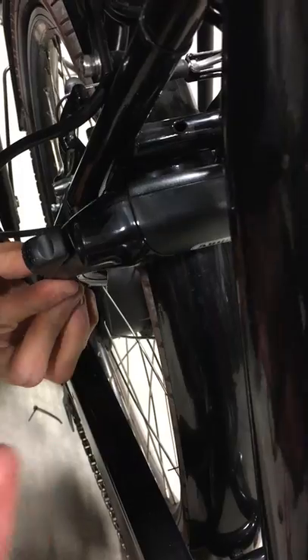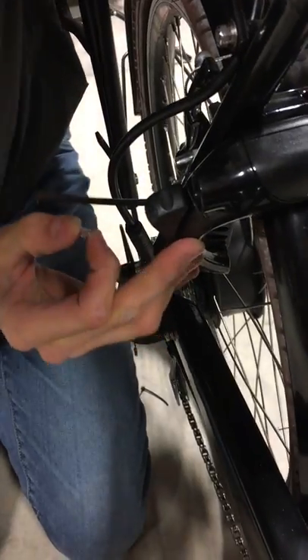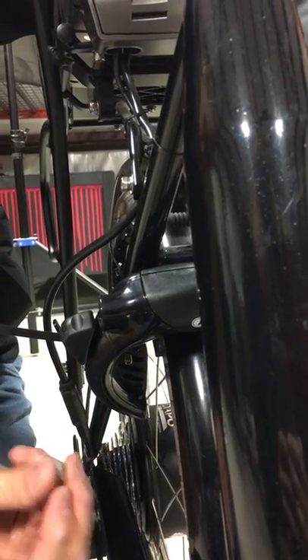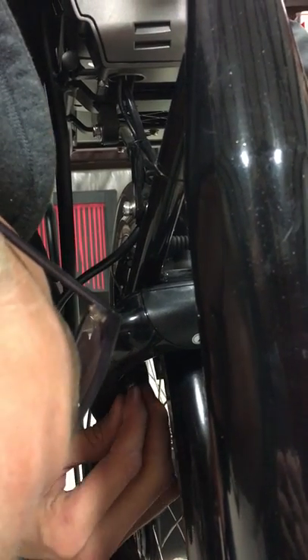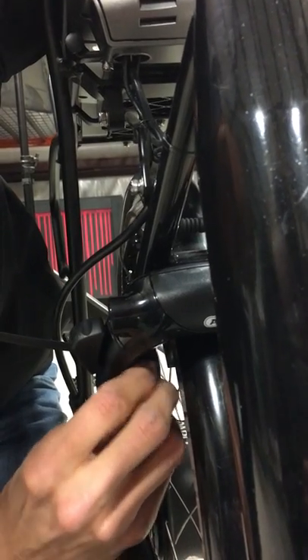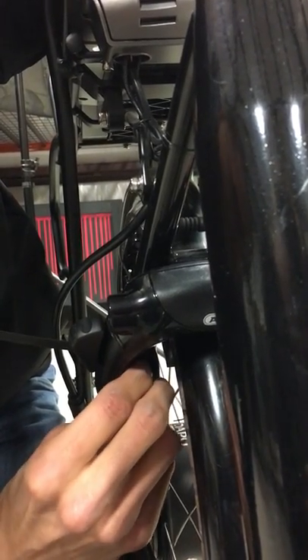To keep the lock in place, use the lock nuts that are included. If you can get the washers on, you can put those on, but I've found the screws aren't quite long enough to fit both the washer and still have enough thread left for the nut. So I'm just going to use the nut. I've read that several others have had that same issue with the washers — it seems to be a design issue from ABUS that they need to make the screw a little longer. Hand tighten the nuts on there just so it stays in place.